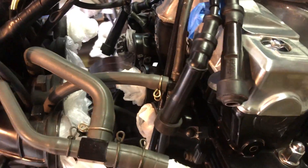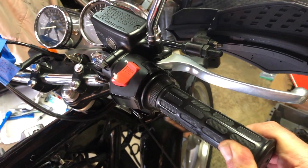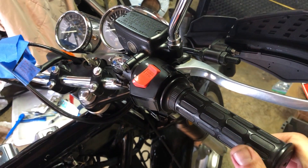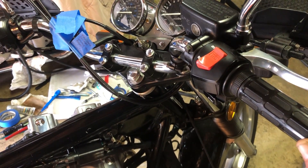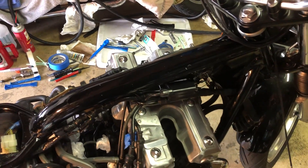If the carbs are on the bike, what you want to do is keep your throttle fully open. To make things easier, just take a few turns of masking tape and wrap it around the grip and the brake lever so you can keep the throttle open during the entire test, so the butterflies can be open and the engine can breathe and take in the air needed to do the test.